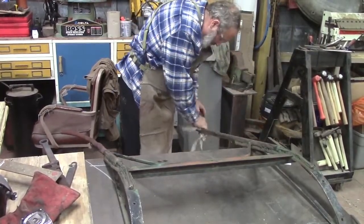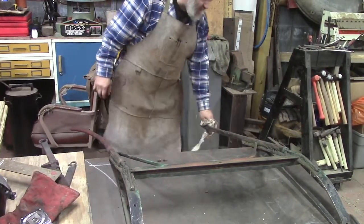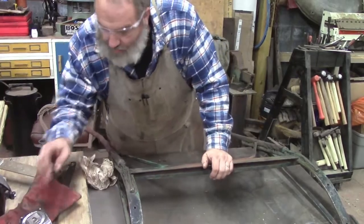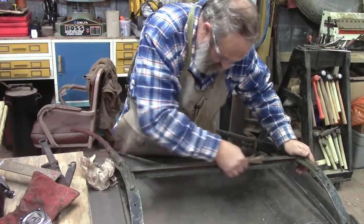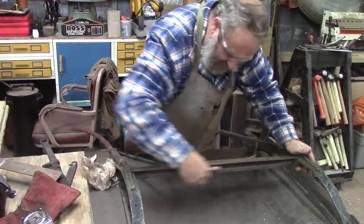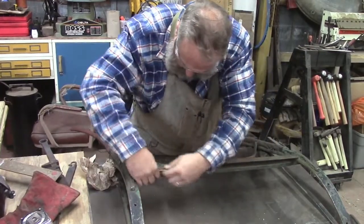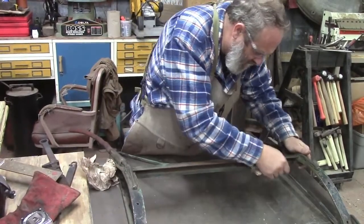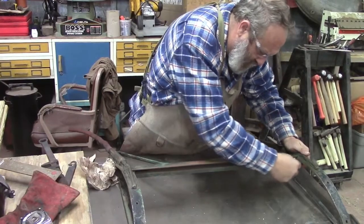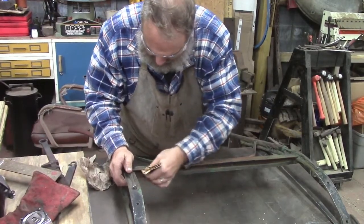As you can see here, I'm doing my final sanding and getting all the rust and debris off as I can on this piece. If you want the best paint job, go over it with brake cleaner, spray it on and wipe it off — it evaporates into a perfectly clean, oil-free finish. Even the oils from your hands can affect your paint. I didn't have any that day, so I sanded it and wiped it down with a clean shop rag, kept wiping until the rag stayed clean. This took significant time — probably 30 to 40 minutes.